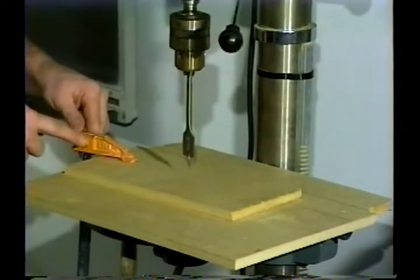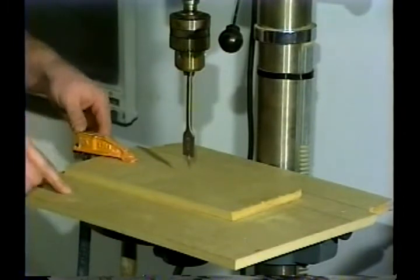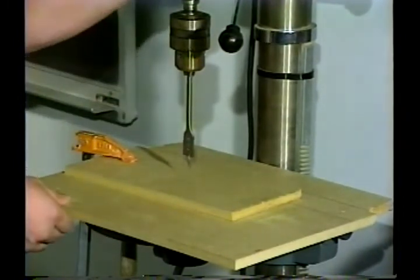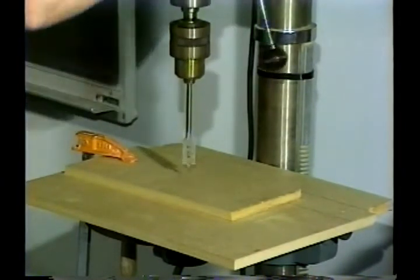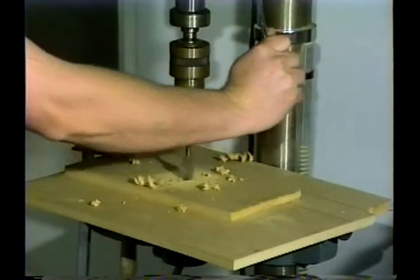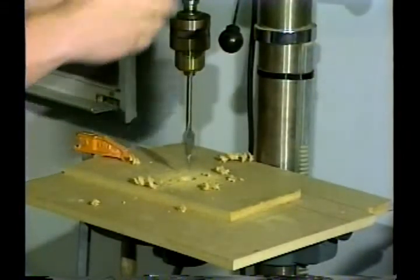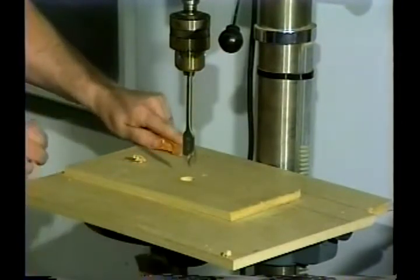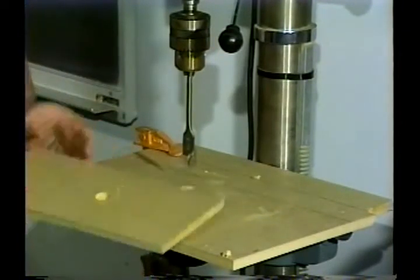Next, clamp your work down with a piece of wood beneath it to ensure you don't damage your bit or drill press. To countersink buttons, we will use a wood bit about 1/8 inch larger than the diameter of the buttons to account for the vinyl. A countersink like this is used for a panel to look like this.